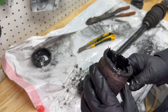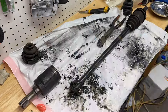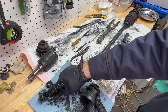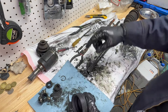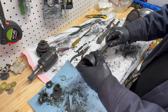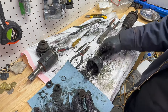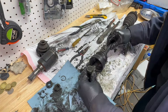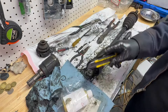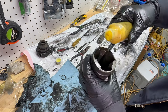Now I'm going to clean this out and fill it up with new grease. I had to take this snap ring off — I'll use two flathead screwdrivers to get this bearing holder off the shaft. Now that I have the new boot on, I can slide this. Now that I've cleaned this out, I can open up my new grease and probably put half in here.